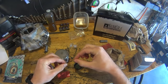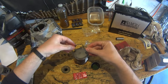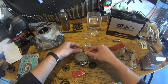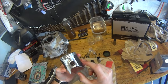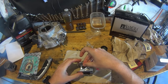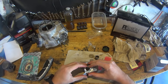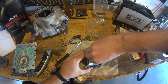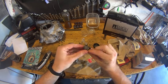This is the second piece - same thing. I'm going to lube it up just so it slides a little bit easier. I start from the back again, go around and in. They're both aligned. There's one pinhole over here and one pinhole over here. I'll put a clip on this side and slide everything from this side into the piston. To make things easier, I'm going to install one of the clamps on the piston while it's out so I don't have to struggle putting it in when working on the motorcycle.